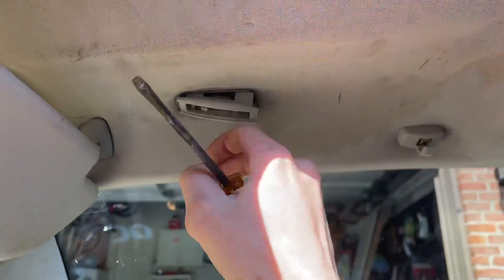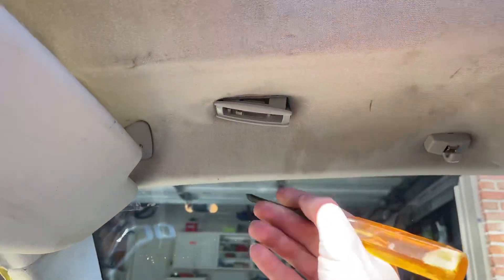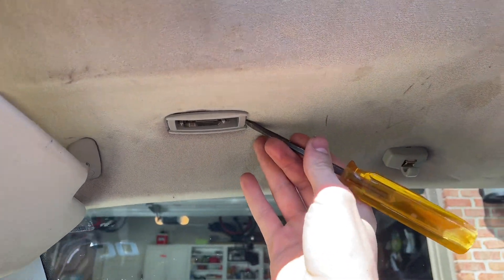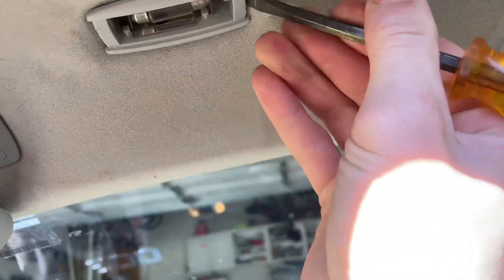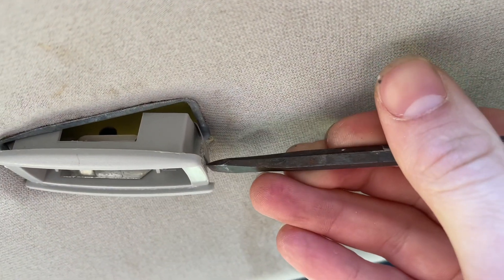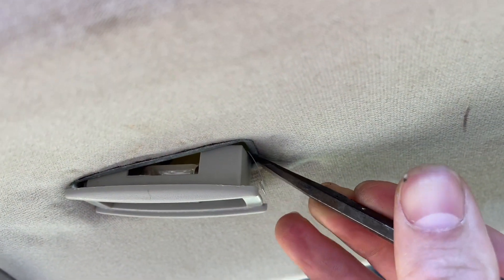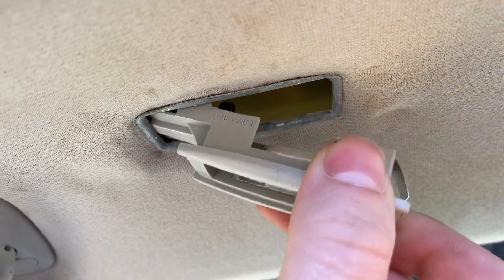I was struggling with this one and couldn't figure out how to get it unclipped. I'll put it back in just to show you how simple this is. Take a flathead right here, push up a bit, get it into that clip — make sure you go under this little metal right here. Get that clip back there, you'll hear it click, and it'll simply slide right out. Push up against this part here with the screwdriver — just dig up in there right under this metal part, make sure it's under there, you'll be able to click it down and then this will just fall out.